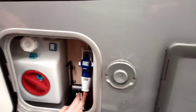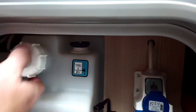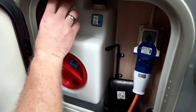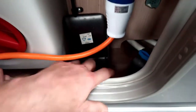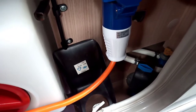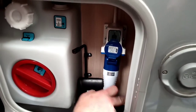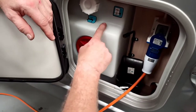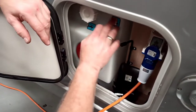This is where you plug your 240V in if you're on site. If you're filling with water, you need to have this little wheel — can you see that little wheel there? — turned and locked down; that will allow you to put water in here and fill it up. This is a frost protector valve — the blue one — it has a little button at the bottom that needs to be pushed in. And if you can see around the corner there, there is a yellow one — the yellow one is for your gas boiler to let water into the boiler. As it's showing on here, it says 110 litres or 20 litres. If you let all the water out on this valve, it will keep 20 litres in your water tank, so you can have it for toilet and kettle while you're on a trip — you're not carrying all 110 litres.